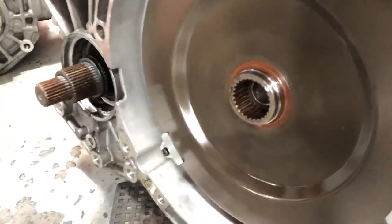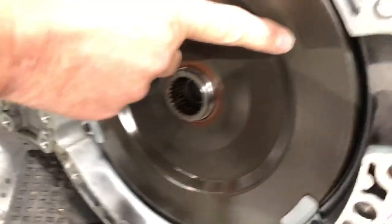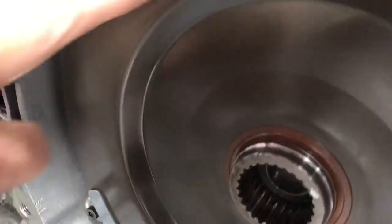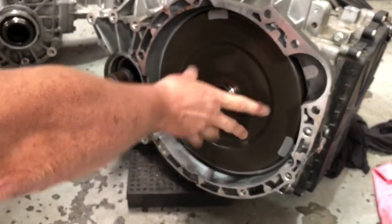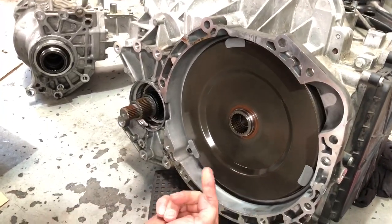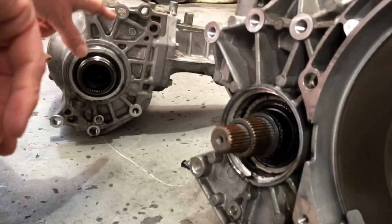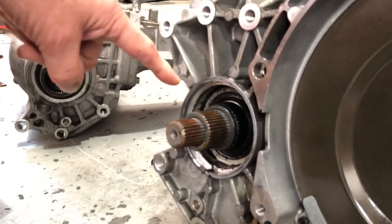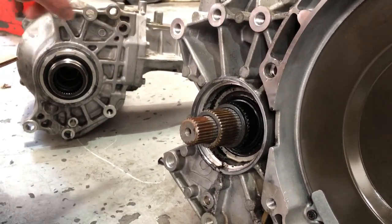What happened in the case of this particular car is someone has reassembled the transmission in the past and it's had some oil leaks. The client asked us to fix them and we found out that when they put this cover assembly back on, this particular seal hadn't been fitted correctly. It's part of the cover and this is what retains a lot of the oil inside the transmission in front of the clutch pack. Because all of this is spinning and this part remains stationary, if this seal is not fitted correctly — and there's a seal in behind there as well — you will get an oil leak which comes out the bottom. Separately, the transmission also had an oil leak from the connection between the transfer case and the input shaft here, because this is part of the front drive shaft system but also the main drive that goes to the transfer case, which then goes out through the rear tail shaft connection to the rear diff to provide the four-wheel drive system.